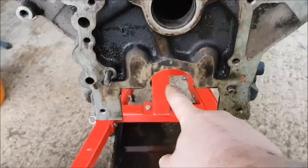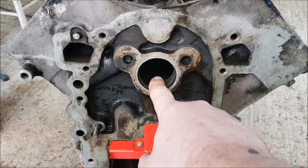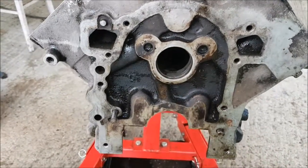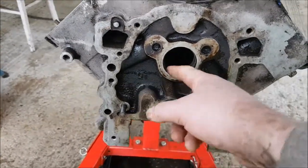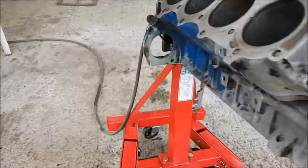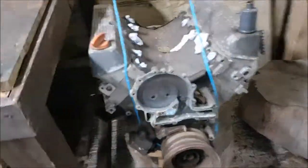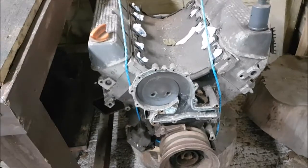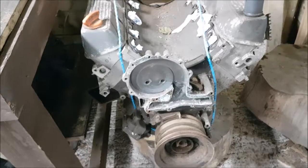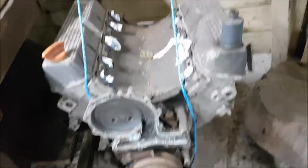The camshaft is about here in the engine block. If we look at the front of the engine block, there's the camshaft bearing, crankshaft goes down here, camshaft goes there. What I'm going to do next is pop all of these core plugs out. I'm going to measure these camshaft bearings as well, because if these bearings are gone too, there's more machining work to pay for, and it might actually end up being more cost effective just to take the SD1 engine apart - the one that was already in the car, which I know works.